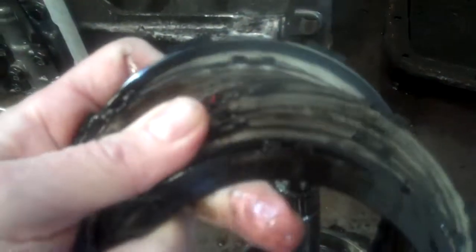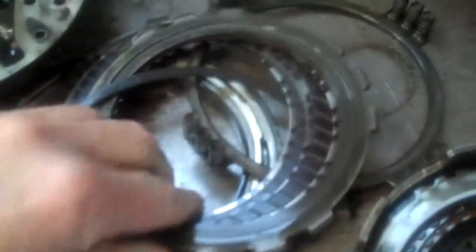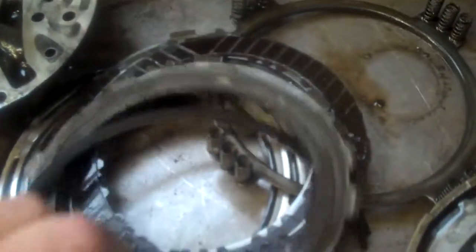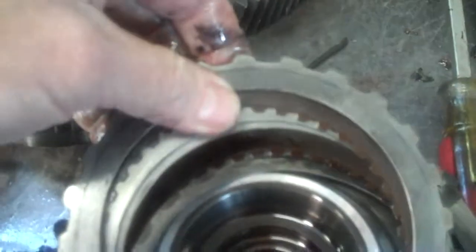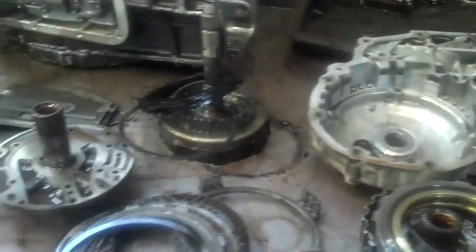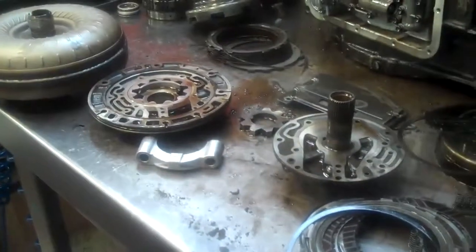Because it was low on fluid, the clutches are metal to metal — there's no lining left. That's the forward clutch pack. The rest of the clutches that aren't completely burned up are burned as well; they're all turned black. They should be tan in color, but they're not.